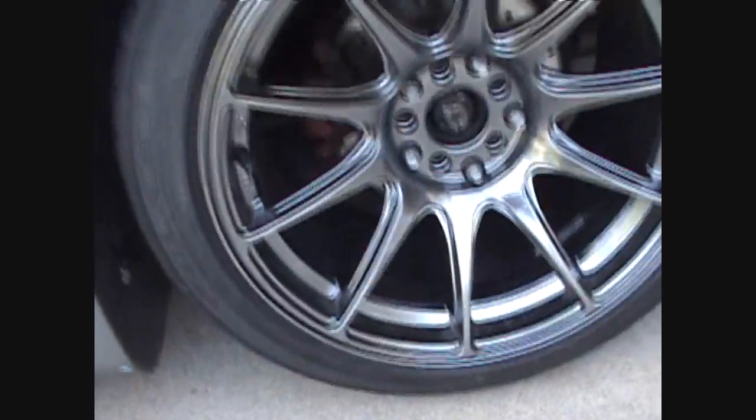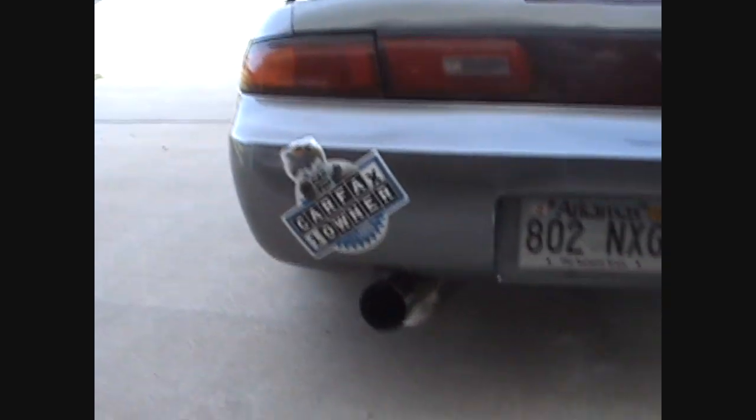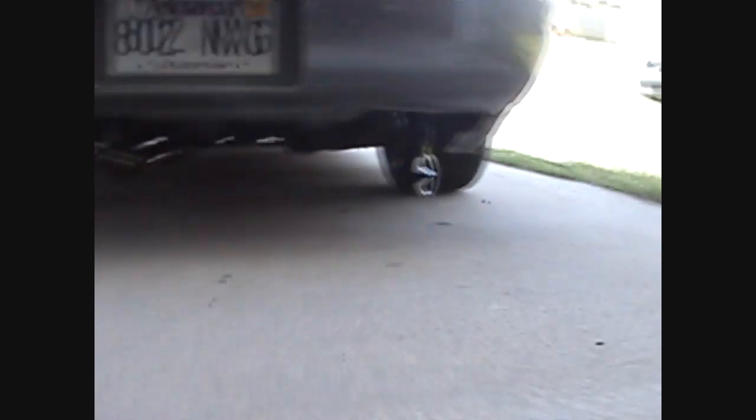It definitely does what I like — definitely got enough angle. The rears are also the same size and they're pretty much toed with a negative two camber, since I don't have my stance arms on in the rear. It's pretty low.